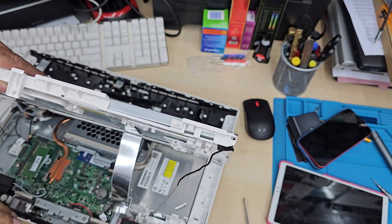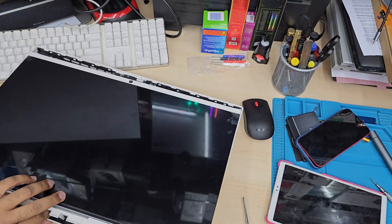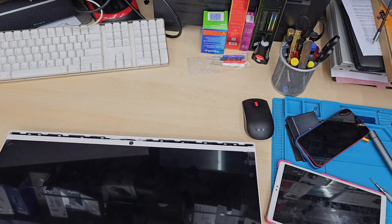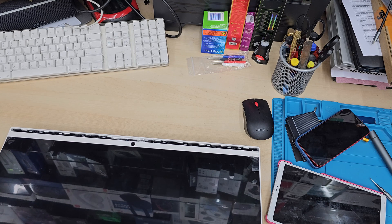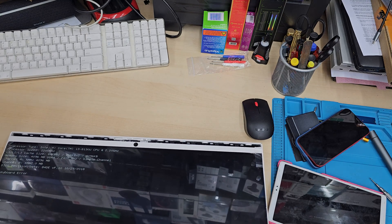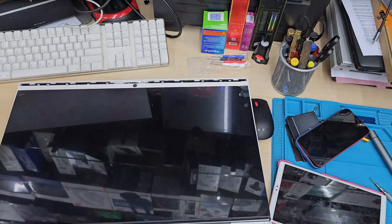It's going in now. There is some sort of fabric tape in there, and pretty much that's all. When you close it, we have to close the front panel first — the webcam side needs to go into the frame before we push down the bottom side. I can see the light comes on before closing it. Because it's very difficult to open and close, I double-checked everything — it looks fine, there is no dead pixel. So let's finally put it back.